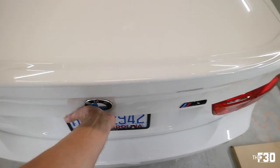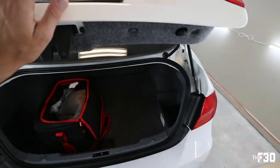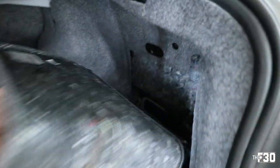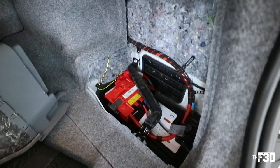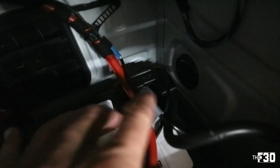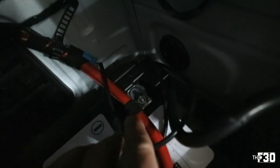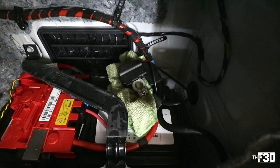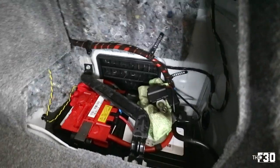In order to do this process, we do have to take out the airbag, so you want to disconnect the battery. You don't have to disconnect all of it, but we're going to go ahead and disconnect the negative. In order to disconnect the negative terminal from the battery, you're going to see a 10 millimeter right there. Spin that around, pull it off, and we'll be officially disconnected. I usually put a rag underneath it just so the negative doesn't hit anything metal and spark.